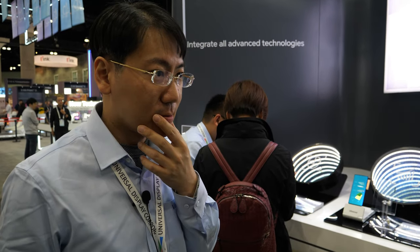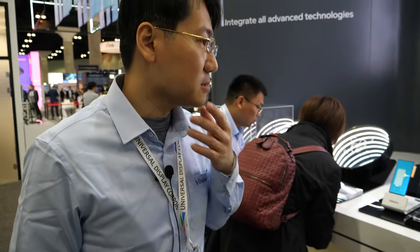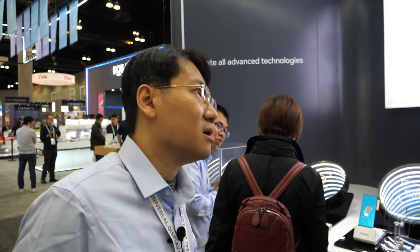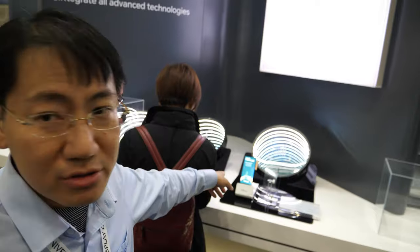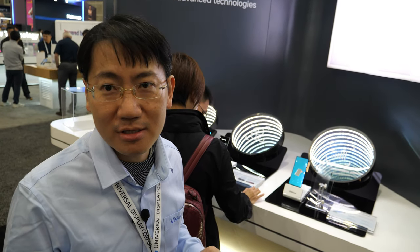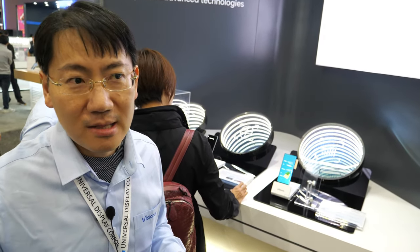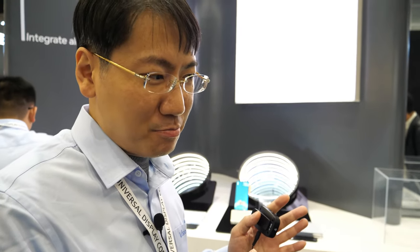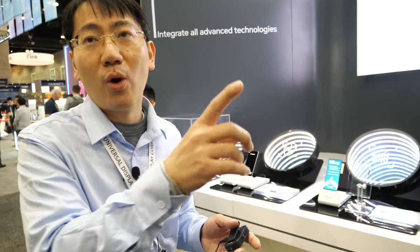How is it compared with the built-in antenna on a normal phone? Can you combine your phased array with the normal antenna, and get even better signal? We can deploy several designs, and we can have a selection algorithm to choose the best one to do the radiation. So sometimes the built-in antenna, sometimes the display antenna, sometimes both together, depending on the algorithm, because when they work both together, the power consumption may be an issue. So for now, we just choose one of them.